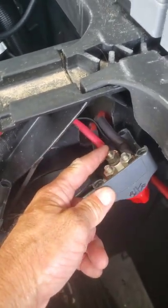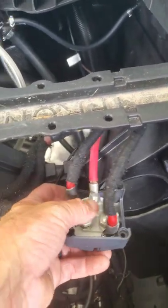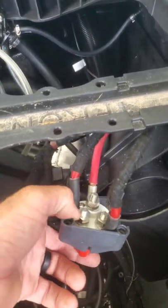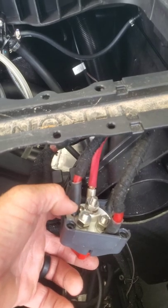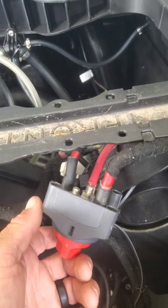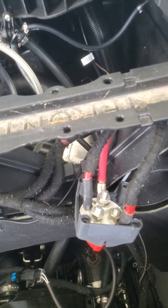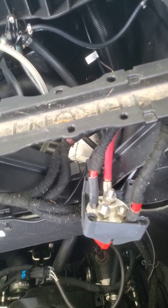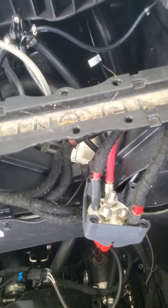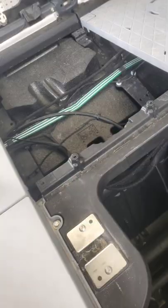The positive I ran to the front two deep cycle batteries, as opposed to the farther back one on my battery shutoff. From the output on the battery shutoff, I come over to the output — or in this case, the input — on the speaker selector: front, rear speakers, since it has the quad corners, so I can turn it on both speakers, front speakers or back speakers. I'm going to mount these up and show you what everything looks like when I'm done.